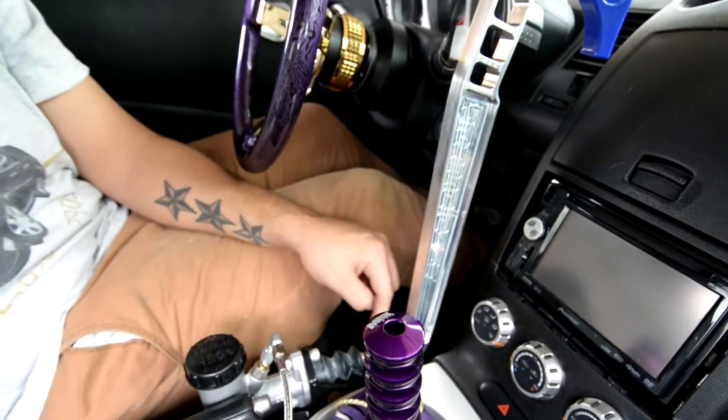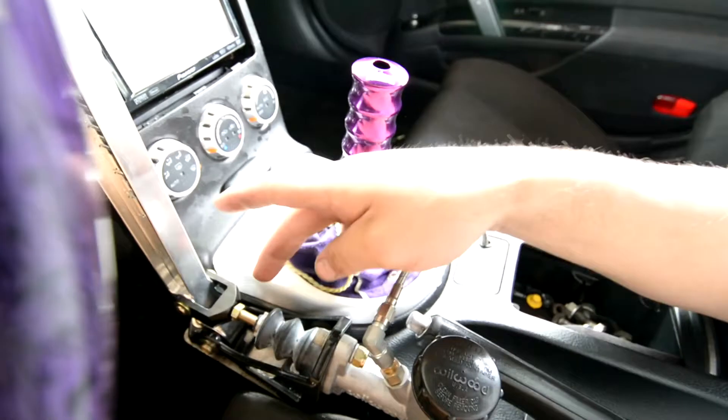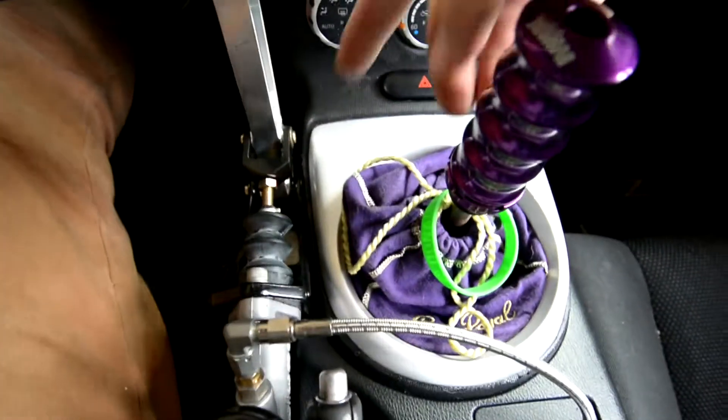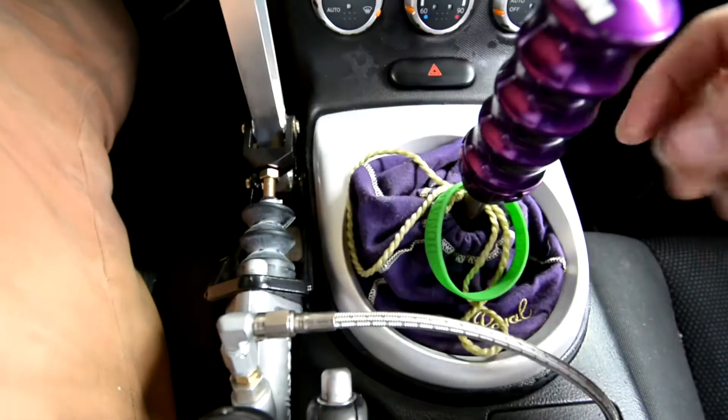Now let me go through how I installed it real quick — it was a pretty simple process overall. All I had to do was drill into the LevelRide concept fabrication bracket that I got from LevelRide, then mount the holes to the shifter boot mount. There are four 10mm screws, so you just bolt it right in, then mount the hydraulic handbrake and mark the bolt points. The longest part was getting the dash back in and making it look clean. I had to drill this part out — practically the entire section. This piece of shift trim is basically sitting on nothing, held by just a clip here and a clip up top.